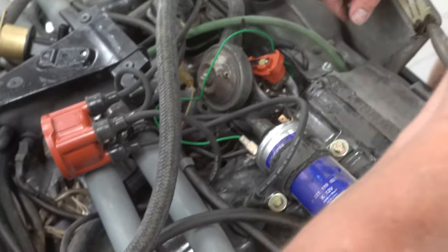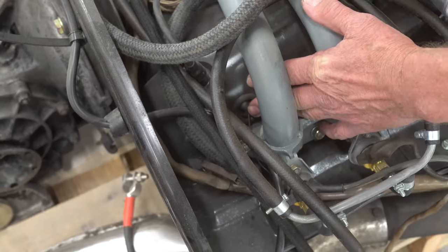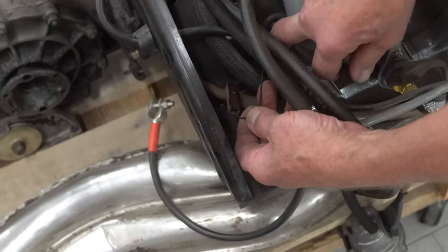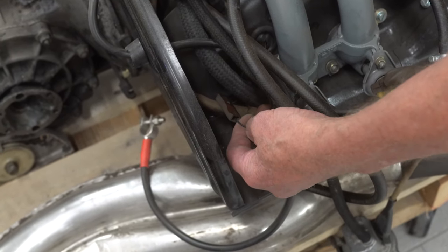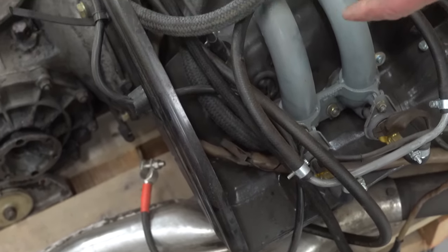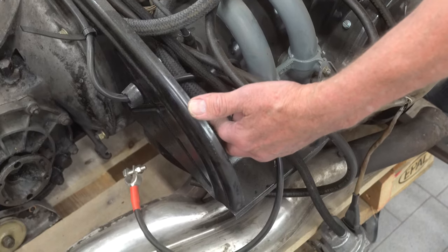The harness routes over here and notice the critical part is the head temperature sensor. It actually goes into the sheet metal, and it's a wire-wound resistor that senses the temperature and adjusts the mixture accordingly. It starts out at 2,750 ohms at 40 degrees and ends up at about 50 ohms residual when it's fully warm. This is a critical failure point — it sometimes fails to where it thinks the engine is cold and enriches the injection duration so much the engine floods out. In the opposite extreme, you can't start your car when it's cold — it starts and dies repeatedly. All it is is the head temperature sensor not giving enough resistance to enrich the mixture.